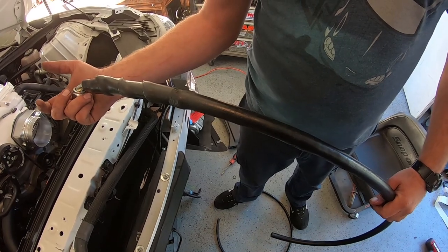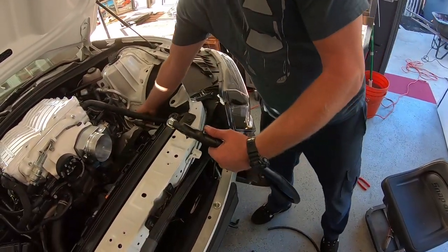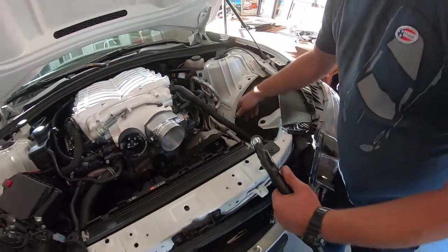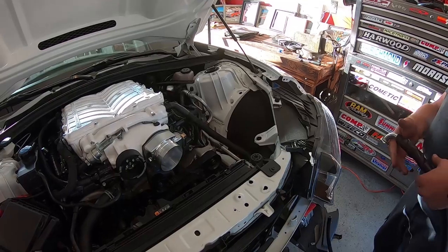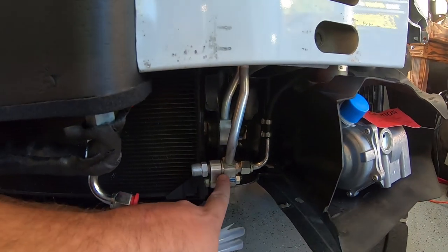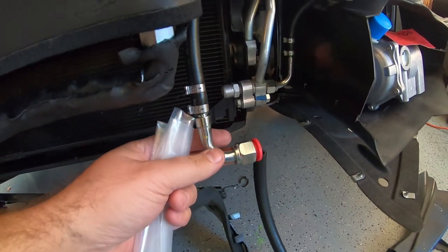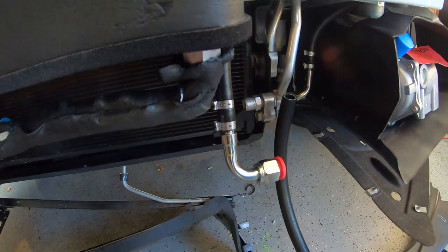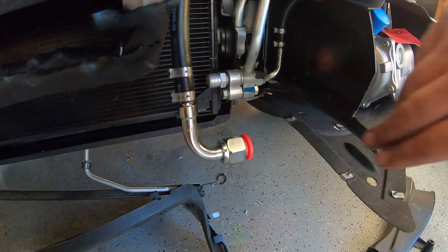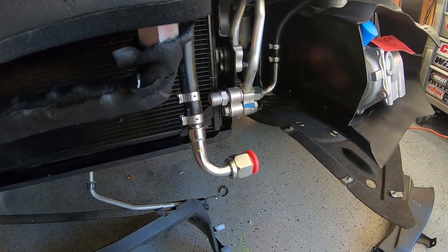We've replicated the fitting on the suction line. This line had tape on it and a separate roll of insulation that said to insulate this line - so we insulated it. We measure it to length, cut it off, then repeat the fitting on the other side, which screws into the suction line. We did do some modifications to the bracket so it would fit properly. Down here is the liquid line - we have it hooked up going into the dryer inlet.